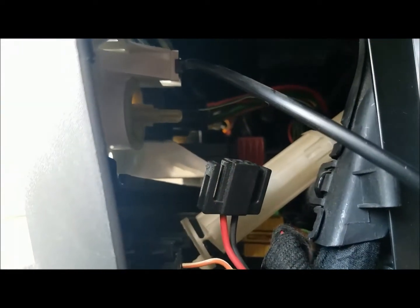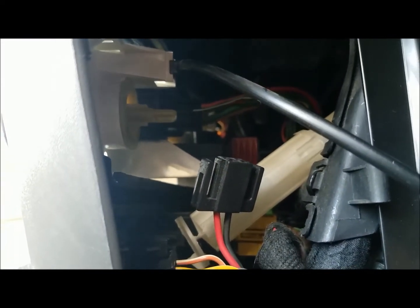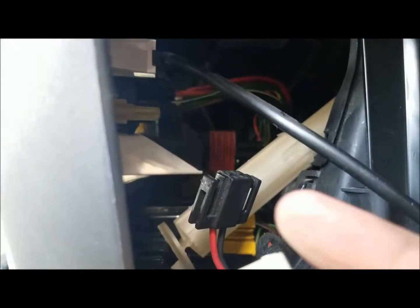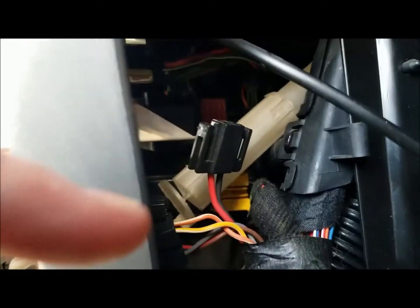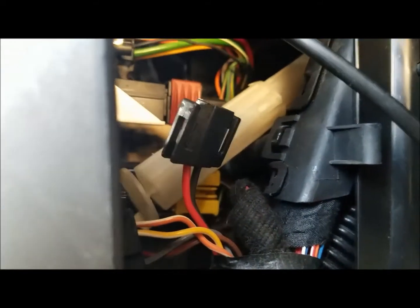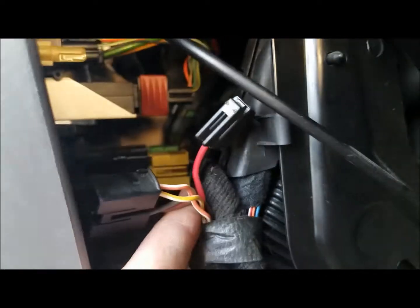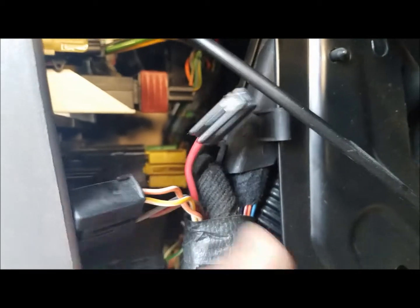Okay, now that the white bin is popped out and pushed forward, the broken end of the control shaft I just pulled off the back of the switch, and I think I can just get that control shaft out and sneak the new one back in. Jeez, yeah, there's nothing holding that in there. There we go. Side note, it looks like this thing is pre-wired for an automatic climate unit. Have to explore that in the future.